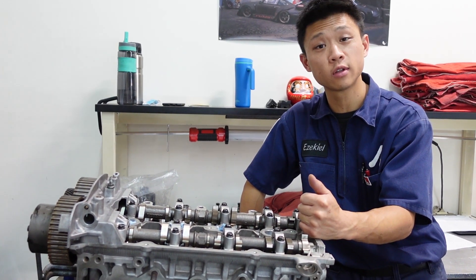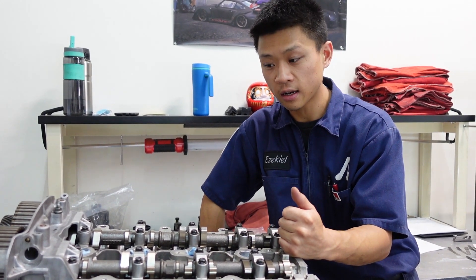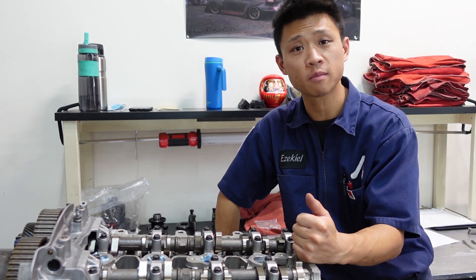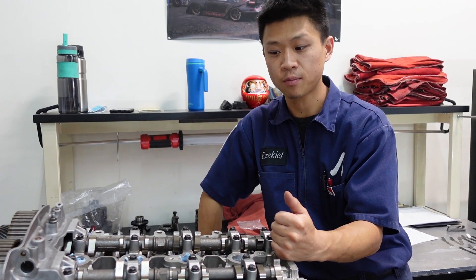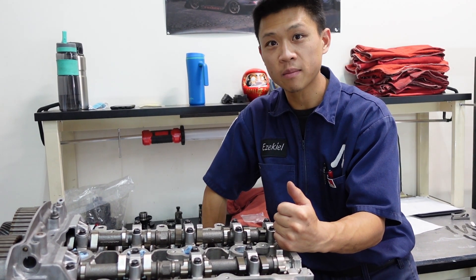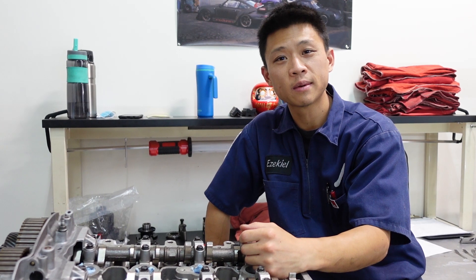So again, this is a 3SGE valve adjustment video. Valve adjustment is absolutely a critical measurement — anytime the head comes off, anytime the valve cover comes off, you should probably check the valve clearance to avoid serious engine damage. Valve adjustment is one of those black arts that a lot of people really don't understand. It's going to differ by every single engine you work on — for 4AGs there are shimless buckets, bucket under shim, different adjustment methods. Thank you guys for watching. If you have any questions, comments, or concerns, leave a comment below. Remember to like and subscribe, buy some merch on our merch store. Appreciate all the support, and I'll catch you guys next time.